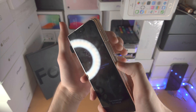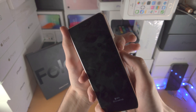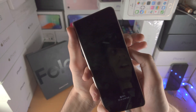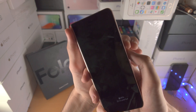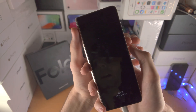We're going to do the following key combination. Press and hold Power and Volume Down together until you see a black screen. If your screen is already black or issues are happening, just press and hold these two buttons for 10 seconds, then release both Power and Volume Down. Then press and hold Power and Volume Up until you see the Android recovery screen.